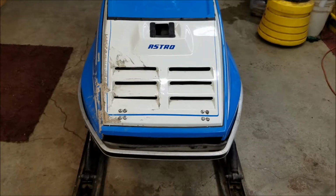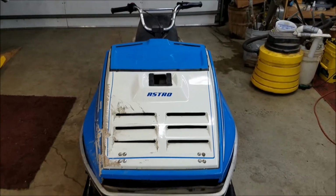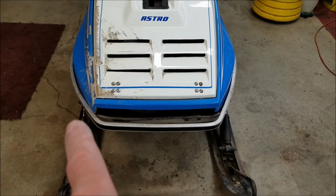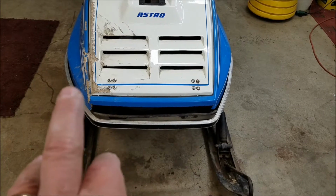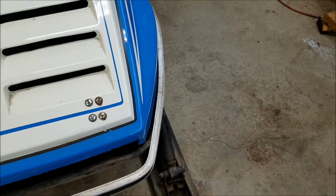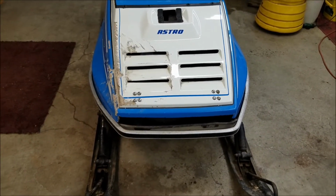Okay, I'm looking at this and it sure looks to me like it took a hit right on the bumper there from the angle. When I come down here, this side sure has a sharper angle going back there. It looks like it's pushed over. And that one's pushed in there. It's kind of rounded off. I think I need to shift that over a little bit. Get this pushed back in here. That side falls pretty good. You can kind of see the gap on that side. So let's see what we can do about making that fit a little better before I start final assembly.